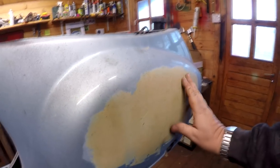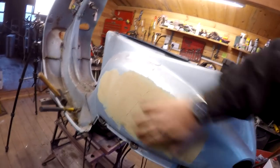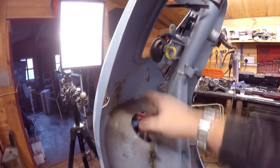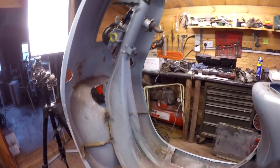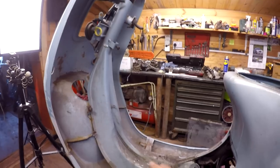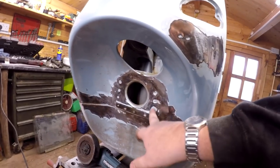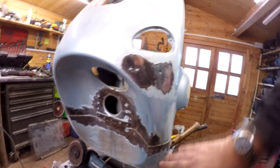Now with these repairs here I had to overfill these, for the simple reason that it's very hard to get access in the back of these. I got most of them out — I was able to come up from underneath and push quite a bit out — but just to finish off I had to smooth them out, so these are going to have to be sanded back. Coming around the vehicle we've got some small rust on the inside. I'll sand this back by hand and treat it with Vactan, just like on these seams. Then I'll give this a scotch bright and a clean down on the inside and just give it a rattle can paint with black — no need for top coat and clear coat in here, it's all covered up anyway. Then I'll dig this crease out and the little bits around the rivets and give it all a Vactan rust treatment.